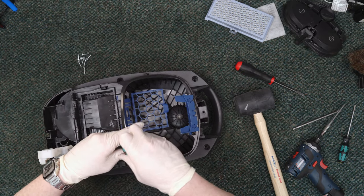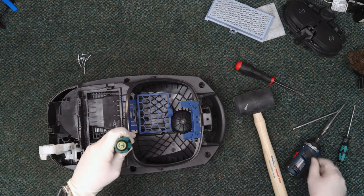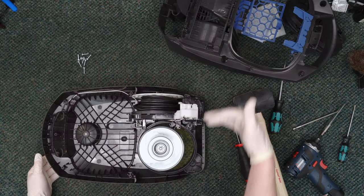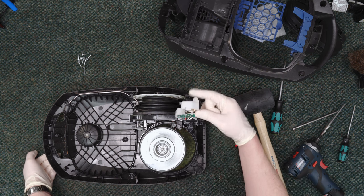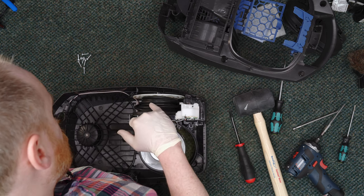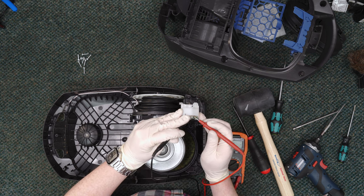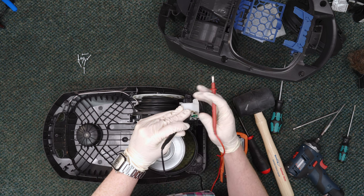This piece clips down from the lower body up to the upper body, so as we're separating this, once we get it further apart we need to push on this clip while we lift this off. Now we're down into the machine. Got the motor right here which looks fine — a little carbon, nothing abnormal for this age. You've got the switch right here, your rheostat and control board right here, your cord reel, and leads going out to your power nozzle. We're going to make sure the switch is in the on position.